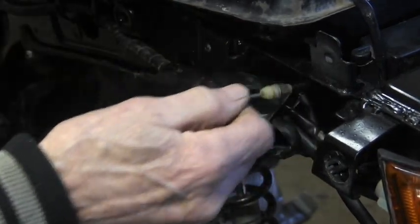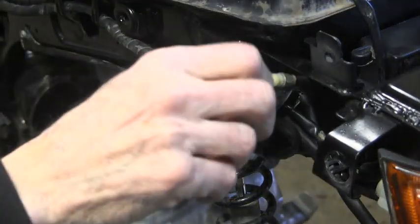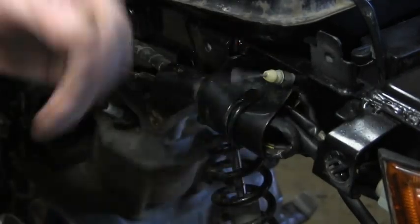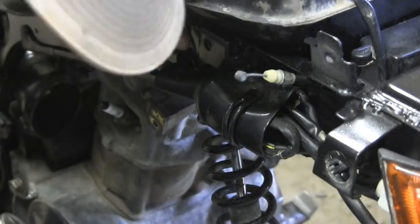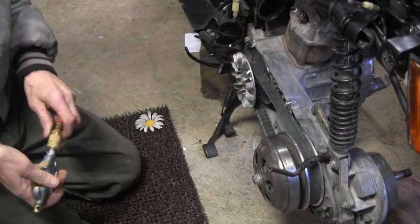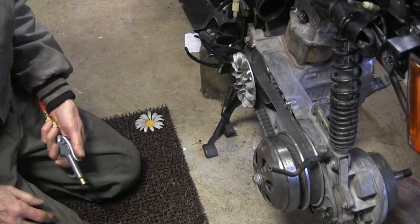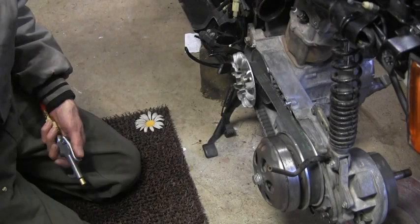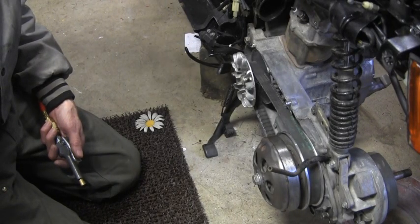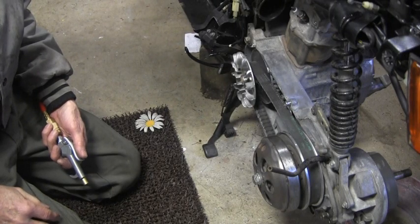Now I just have to figure out something to do with the seat latch to get to the fuel tank. I may just leave it and see what happens when I get the plastic on — so the fuel tank is on. I was wanting to blow all this out yesterday but my compressor wasn't charging up, so I had to tear the head down. It's an old Thomas wobble compressor — instead of a piston going up and down, it just sits there and rocks, and builds up pressure really well. It's about 35 to 40 years old and they have a rebuild kit for it.